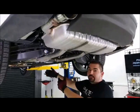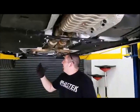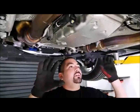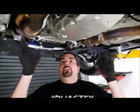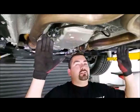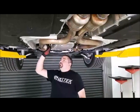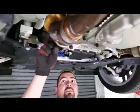Anything forward is generally a cat-back. A full cat-back is going to go from essentially this point right here. A lot of manufacturers are doing something different with these six-gen cars because of the different catalytic converters and connection pipes, but generally a cat-back will start either from this point or this point and go all the way back. Some manufacturers actually make it go over here, so it's essentially the entire exhaust going all the way back.